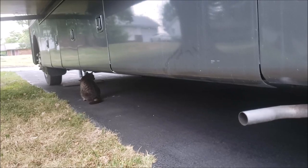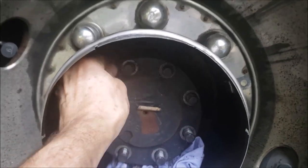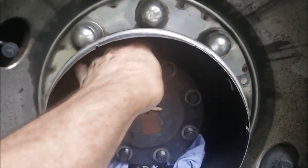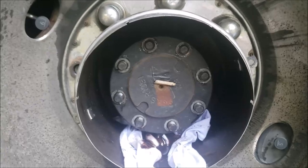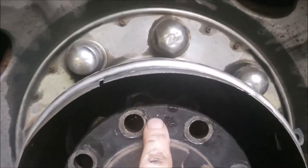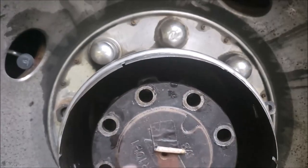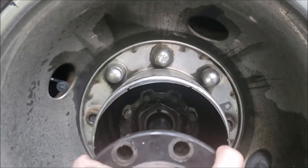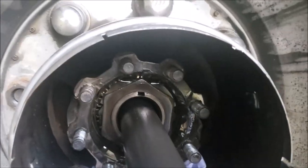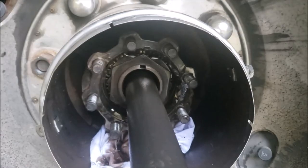Hello Francine — that cat's always here to help. I've got all the nuts loose. Before I pulled this axle out, I put a little indentation right there because I always like to put it back the way I found it — that axle's been in that spot its whole life since 2004. All we gotta do is slide her out. And yeah, we've got a gasket that has failed. That's where we're leaking.